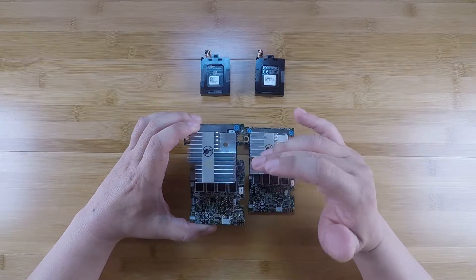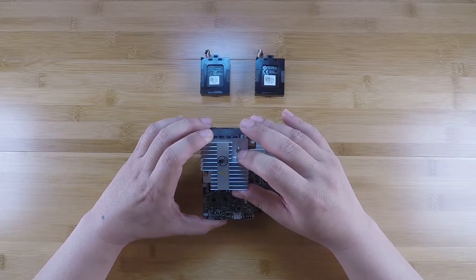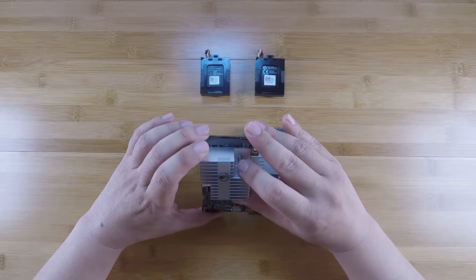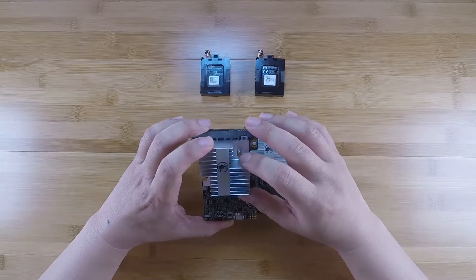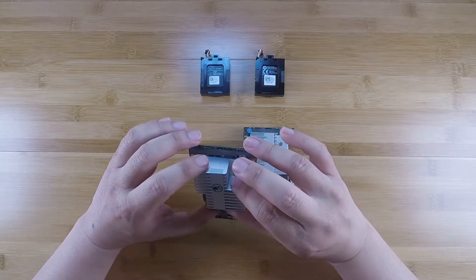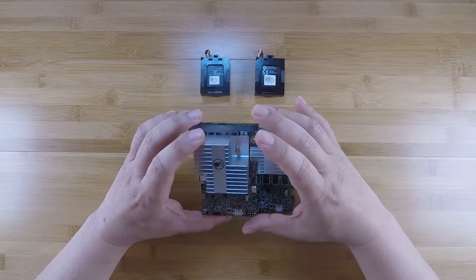The second challenge is that because it is natively running as a hardware RAID controller, you really have to change the personality of the card. Unlike other cards which can run the IR firmware — kind of like pseudo RAID — this is drastically different. And because this is in that Dell slot, you can't just erase it and hope the next firmware launch will automatically fix the SBR, because with the wrong SBR contents this will prevent your system from booting. And you can't really stick this in a normal PCI slot, so there are just a lot of challenges.